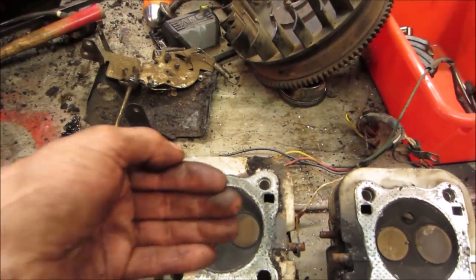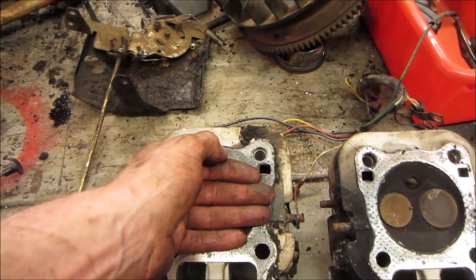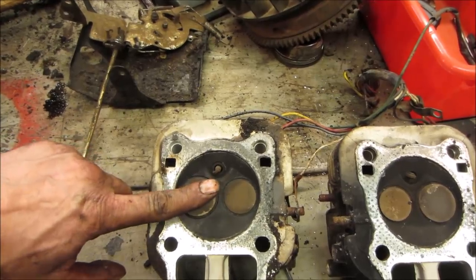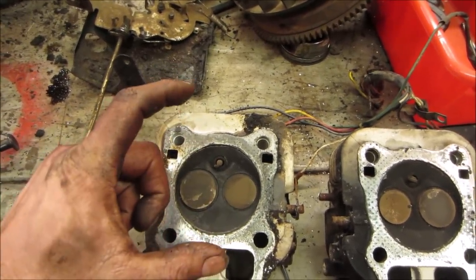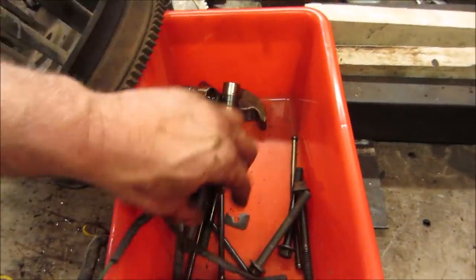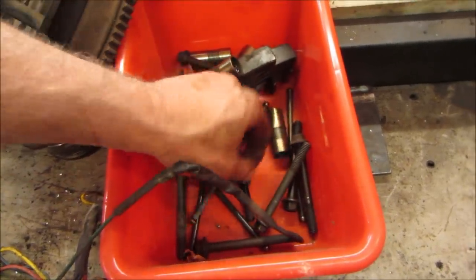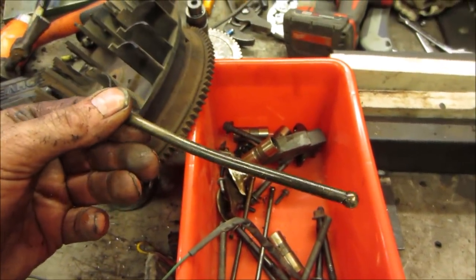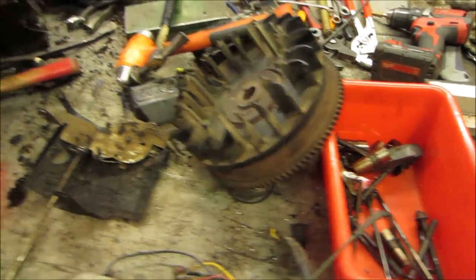My thought was that a piston came up and stayed up really far, because the rod got disconnected from it. Then the valve goes to open, but the piston is already in the way and it can't. So the weakest thing in the link, the push rod, bends. That's the one. And with the pistons, I don't see any damage.